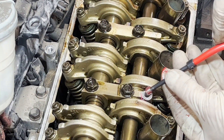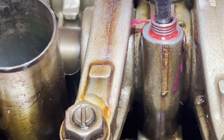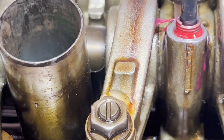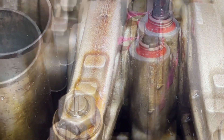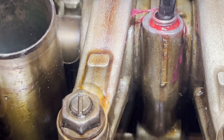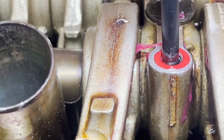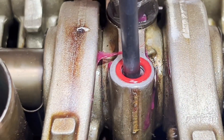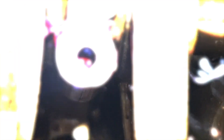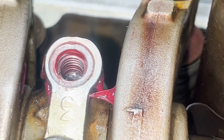Do not jam this in the hole. Just turn this right in here. You want to keep pressure on it and continue to just turn it in. We want it to go a little bit below — we don't want it level with the top of the surface, just like the threads start below the surface for the ones that are already there. We're just below the surface where the good threads start. That's where we want it.